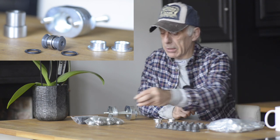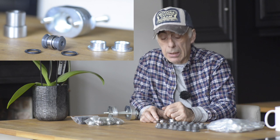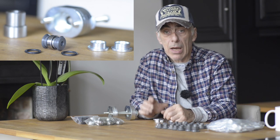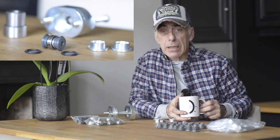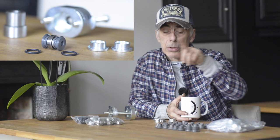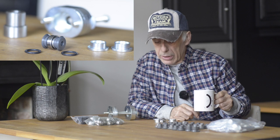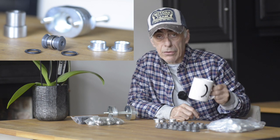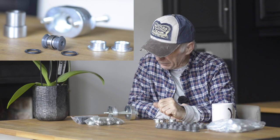Changing those bearings in the wishbones can be a tedious job once you have your clamshell on the car, but if it's removed then it's easy. If the clamshell is still on, you will have to remove the inner liner of your wheel arch to get access. Place the car on a stand and I'll show you that in the shop very soon.